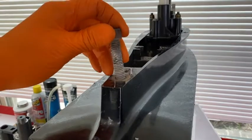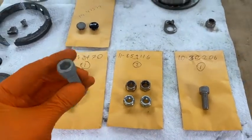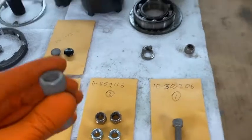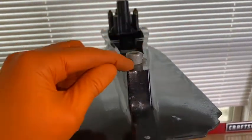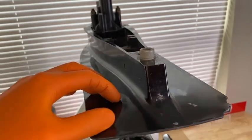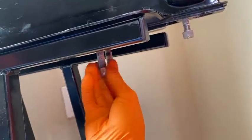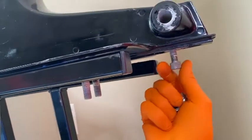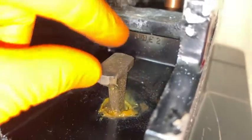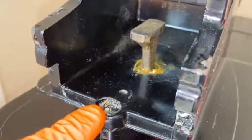Ensure that your seal is properly flush in position with the top portion of your water pump housing. I also added some 2-4C grease to the oil seal here. Slide to the back and remove the bolt that the anode secures to. Here is the old bolt we just removed and here's the new one — links to purchase these parts are in the description. Very important DIYers: you have to install this bolt first, prior to securing the lower unit back to the upper unit. If you forget to install it at this step, you will not have the option to install it when the two are connected. Coming down to the upper unit, remove two 5/8 nuts on the bottom and the bolt on the back. Back up top, ensure that the shifter is placed in the forward position — perfectly straight and facing the screw hole.